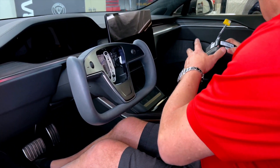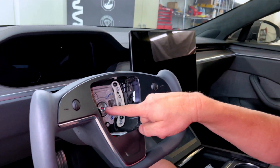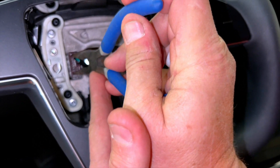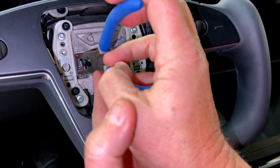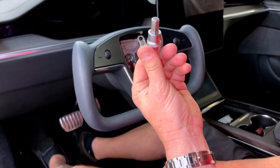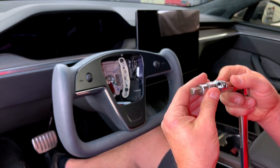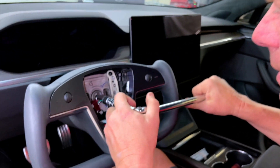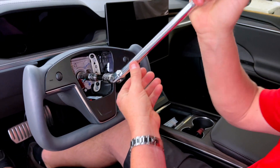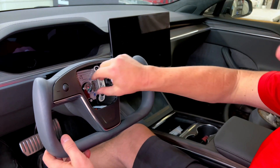Let's put the airbag aside. Now there's one more plug inside — this is the power plug. Grab the clips and pull, making sure you've got it on the top and the bottom. Now the steering wheel is ready to come out. Use the 10 millimeter hex socket we send you, attach it to a torque wrench or any long adjustable socket, and turn left. Look how easy it comes out — just unscrew it and remove the steering wheel column bolt. Don't lose it.